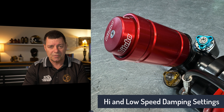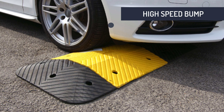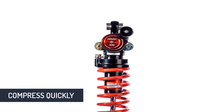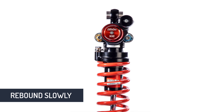This particular suspension kit from Bitubo has compression and rebound damping on the front, and on the rear it also has high and low speed damping — so you can adjust both rebound and compression for low speed and high speed bumps. As Joe Salter at Ride Dynamics explained it: if you hit a significant bump like a step or speed bump at speed, the rear wheel needs to move up quickly — that's high speed compression. High speed rebound is as you come off the bump. Low speed is those rolling type bumps with slow compression and slow rebound.